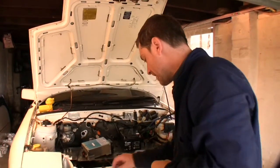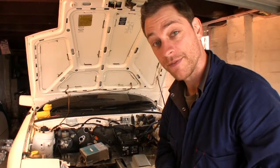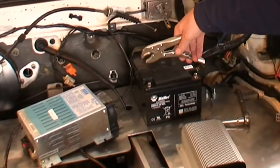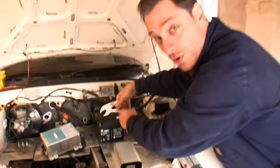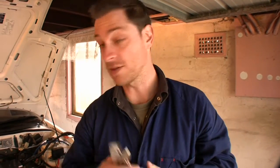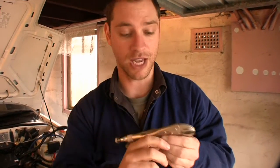On the subject of wiring safety - how many times have you done this? You need to do up a battery terminal, your metal tool touches two terminals and zappity zap zap - sparky badness. Now that's on your 12 volt battery. Scale that up to a 144 volt 90 amp battery pack and you won't be there to tell the tale. So what you do is get insulation tape, gaffer tape, whatever, and you wrap your tools in tape. If you do arc across a couple of connectors with the edge of your tool, nothing will happen because it's insulated.